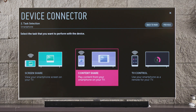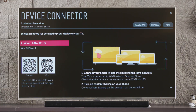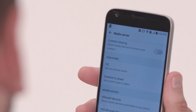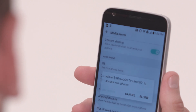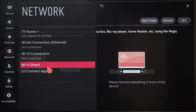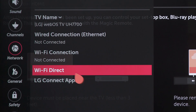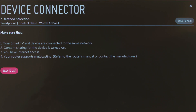For Content Share, you will need to download and install the LG TV Plus app for compatible Android or iOS devices. We even provide handy QR codes right on the screen that you can scan to make this step faster and easier. The content sharing feature on your phone must be turned on in the appropriate settings, and your phone and TV need to be connected to the same network over Wi-Fi or a wired LAN. The TV gives you a handy reminder of its network. Also, Wi-Fi Direct lets you connect wirelessly without the need for a router. Click the help button for advice if you encounter any difficulty.